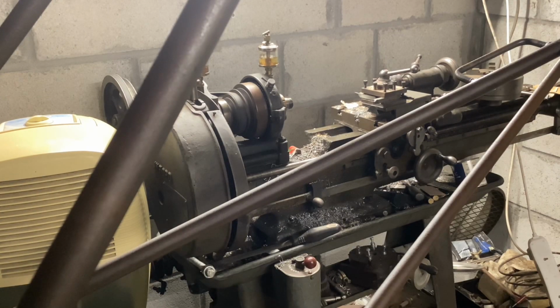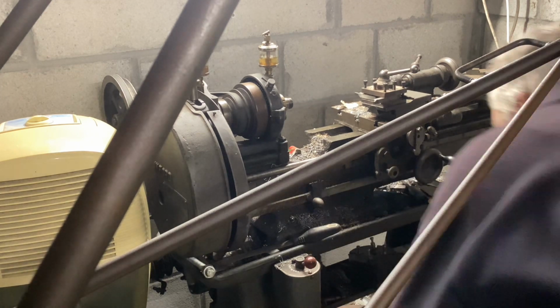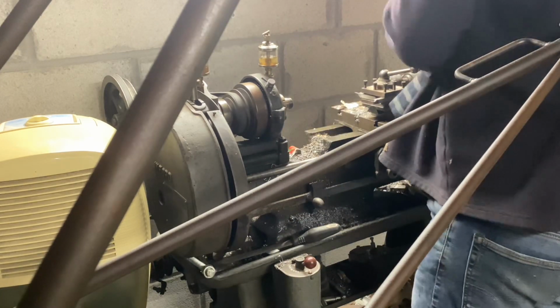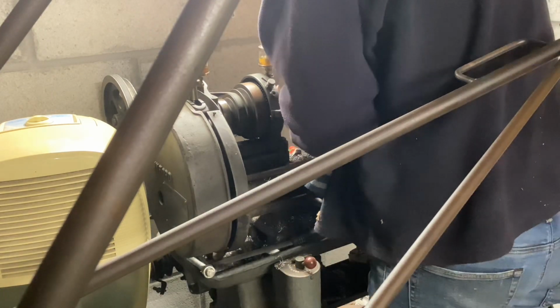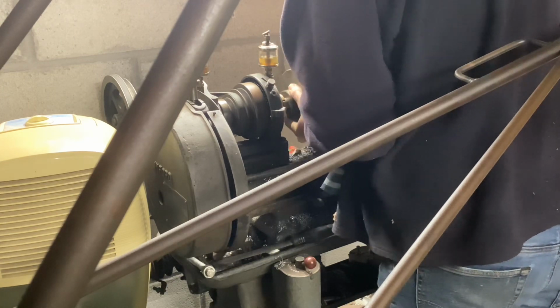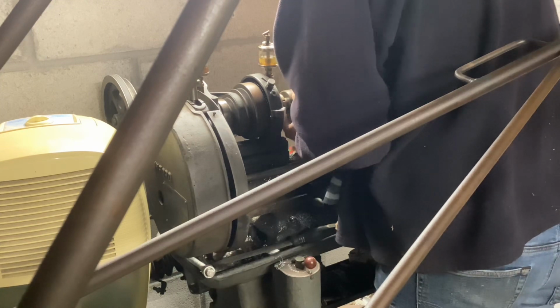I need to put the pistons in the lathe and turn the gaps for the oil control rings. It's not very easy to film because the Aeronca C2 fuselage is poked through the machine shop. I wouldn't describe it as in the way, but I have to go under it to get to the lathe. Just like Robert Maxwell, I'm going to be bobbing up and down for some time.